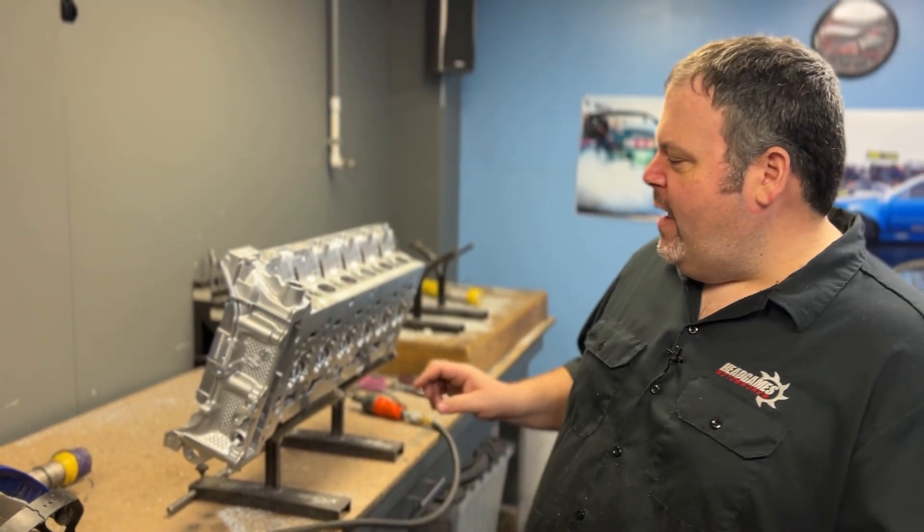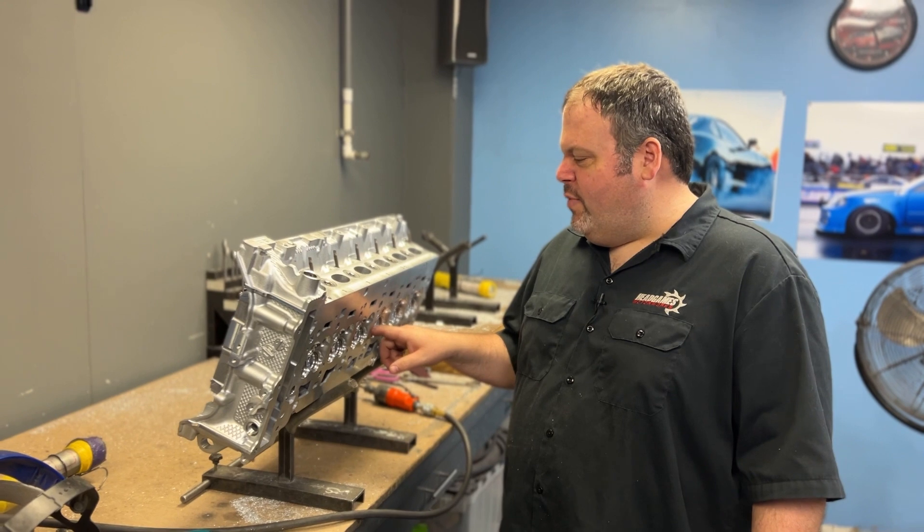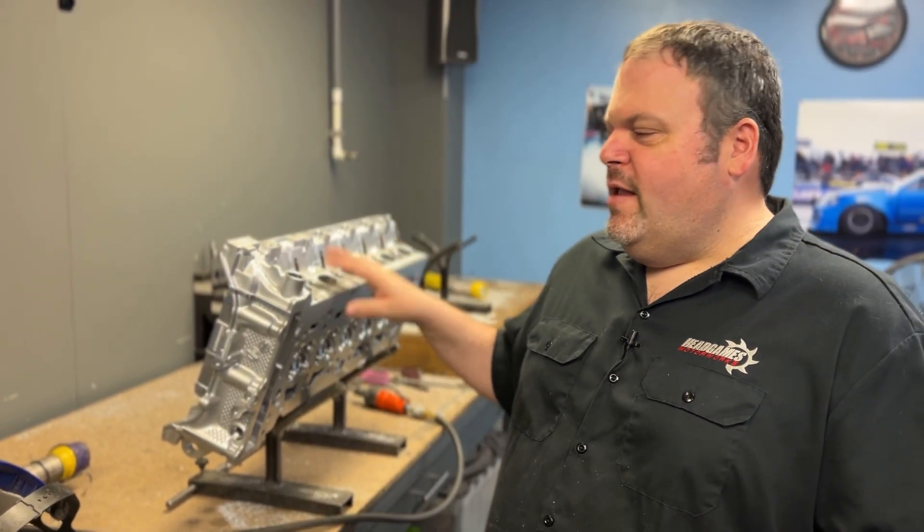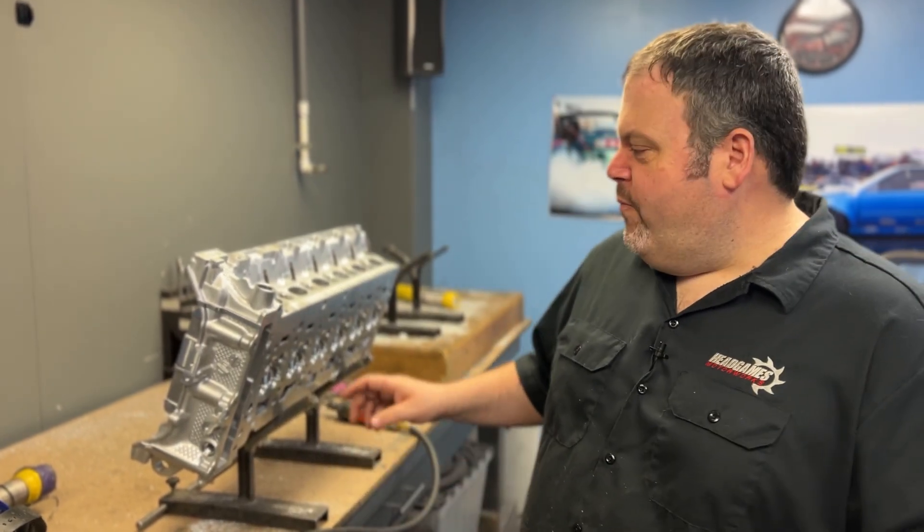With solid gains on the intake and solid gains on the exhaust, I'm feeling really good. There is a little hump here, and that hump is for the DI. This build is not using DI, but we're going to digitize this port, which means it's for everybody. Most of the time, when somebody's going to be using a ported head at that level, DI won't be alone — you'll do DI and port injection. With port injection, we can get rid of any nuances needed just for DI. So we're going to take this away, flow it, and then in the next video we're going to valve drop it.